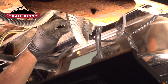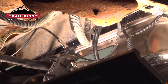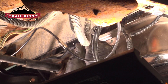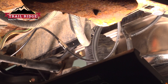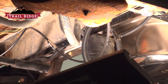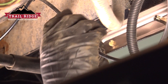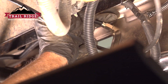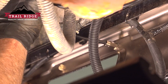You're gonna either drill a hole through your rear bumper or find a space where you want to have the Schrader valve — that's this right here. What we're gonna do is go through where the plate bracket attaches, so you can have it right there through your license plate. Attach the nut to the other side and tighten that down. Take a hose, go through the T, and into the fitting, and push it in place. Just wire tie everything down so that it's out of the way.